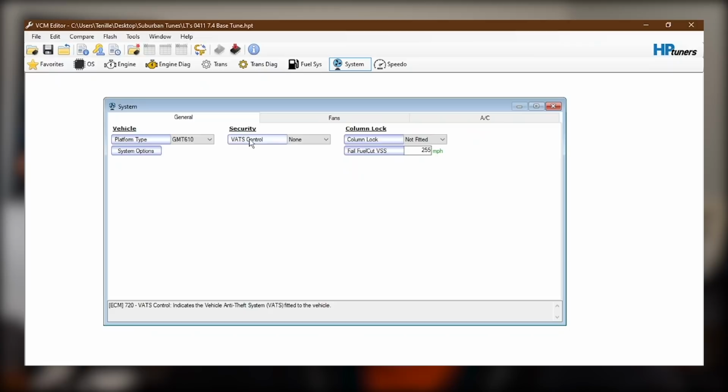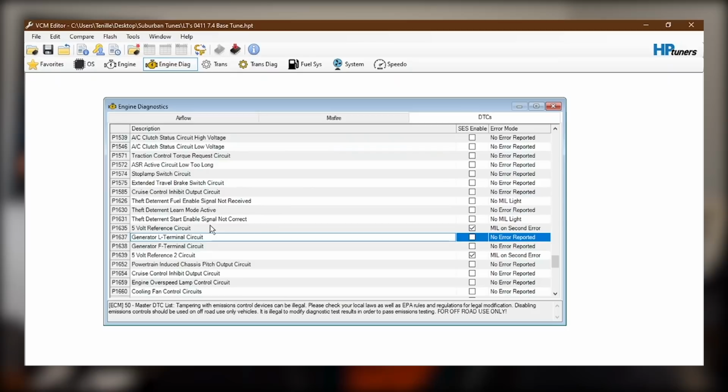Next, there's just a couple of things that we need to make sure. Number one, that there's no anti-theft, because that apparently won't work between the two. And there's an alternator code that we need to disable as well. So we'll come to the system tab, VATS control. That's vehicle anti-theft system. Make sure that says none. It already does. We're good to go there. All right, so it looks like there's these two codes that are already disabled. That's just right here where it says no error reported. So generator L terminal circuit, generator F terminal circuit, those are both disabled, so we should be good to go there. All right, so I think we're just about ready to go out to the truck and flash this in